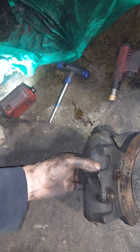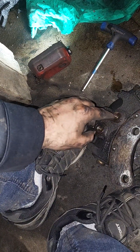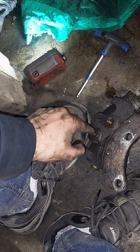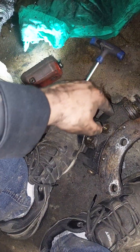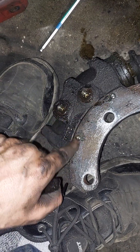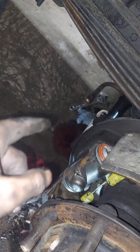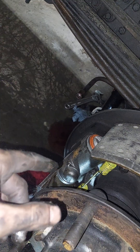This is my frontward wheel cylinder — it goes on as shown. You have your three bolts, and flipping it to the back side, you can see the lower hole is where your inlet is, and this is the outlet going to the rearward wheel cylinder. Here you can see the 5.5 Allen locations. You can't remove the rear wheel cylinder without taking the maxi pot off first, and you have to take the maxi pot off to access the hardware.